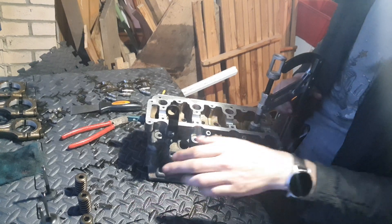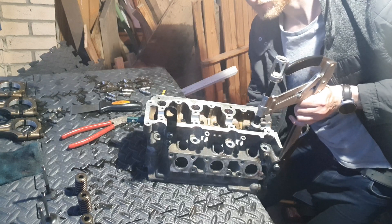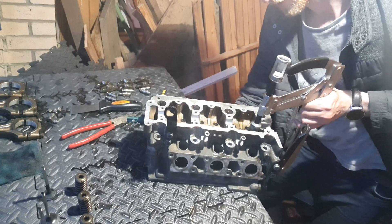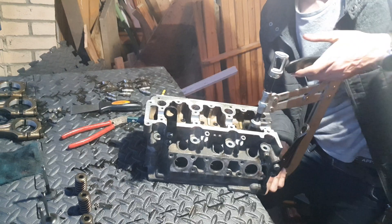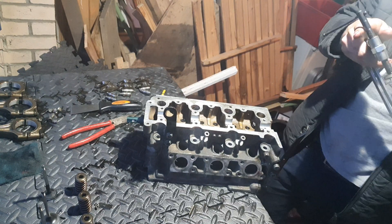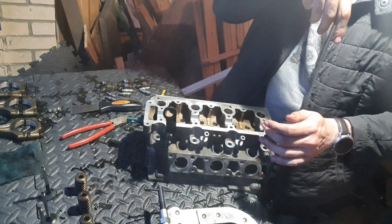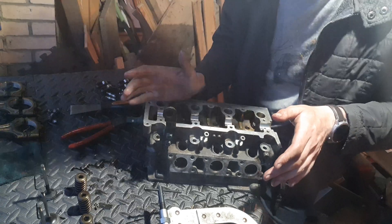Now having got both little retaining clips in there, just to make sure they are fully seated before I retract all the way back, I'm going to slowly back off the screw and check rather than snapping it off quickly and risking it all falling apart again. Luckily that's all seated properly. So that's one done — we'll do the exact same thing to the other five, and that will be the head rebuilt to the standard we want.